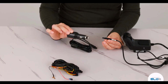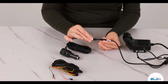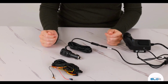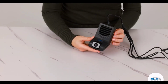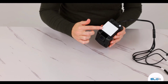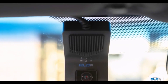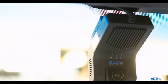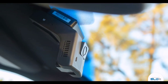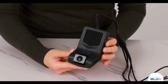Using the cigarette lighter only involves plugging the dash cam's power cable to your vehicle's cigarette lighter USB port, though we do not recommend using the cigarette lighter port — we provide this for temporary use until you get the fuse box installation done. To begin the mount installation, start by carefully removing the backing on the adhesive film and centering it onto the windshield. Adjust the mount so the dash cam is level, and make sure it's in the center of the windshield for optimal and accurate AI calibration. Both the front-facing and driver-facing cameras are adjustable.